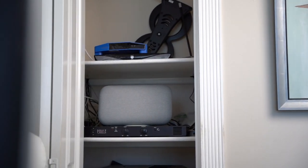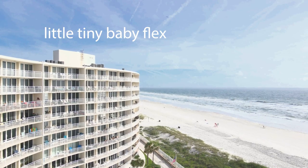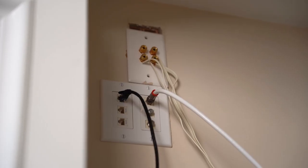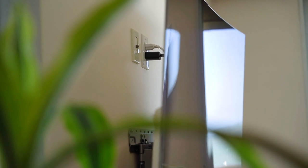Let's start with my current setup. It's really not that overly complicated. I live in a high-rise condo — not a lot of square footage, so I don't really have any trouble with Wi-Fi as it is. I do have quite a few IoT things: a Nest, an Alexa, a Google Home Max, some lights, etc. Those things I do want to segment on their own VLAN. When we remodeled here about 10 years ago, I hardwired every room in the house, so I have Cat5e connectivity to pretty much anything that needs a high throughput connection. I want to take this opportunity to segment out my network and put things on an appropriate VLAN.